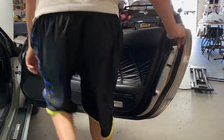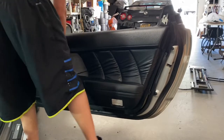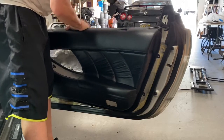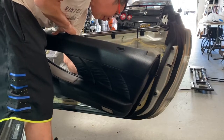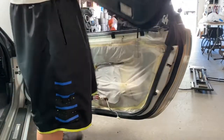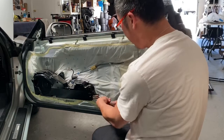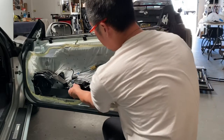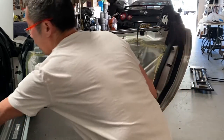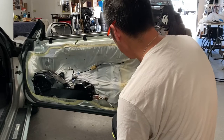Gently lift up and the door panel comes apart. Make sure the panel slides underneath the hole for the door lock — don't pull it too far apart. There are two clips: press the button to release each one, and that'll separate the door panel. Now you can see the cables: one for the dome light, one for the power window switches, and one for the power door lock — that was the one we unplugged from the handle.